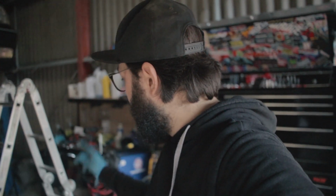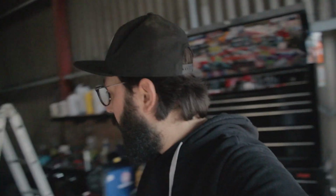Okay, let's investigate. Okay, so I've done some investigation with the power probe, and it seems that it could potentially be the brand new starter motor. So I've got another one here, which is a 2JZ starter from the JZX100. So I'm gonna see if I can put it on there and if it's gonna work. Let's try. All right, she runs. Let's go for a first drive. Hope nobody sees me wearing a GoPro.